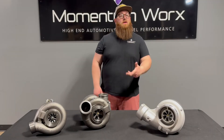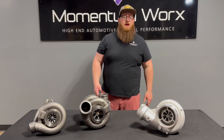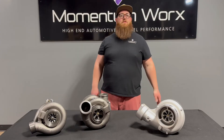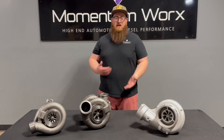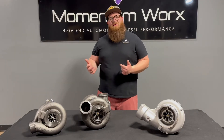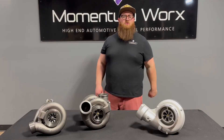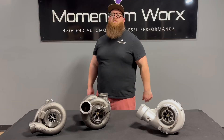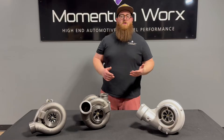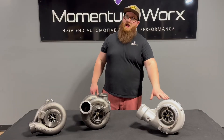Let's talk about power and fuel economy. We get calls all the time — guys say they want to make more power and have more fuel economy. Well, that would be great, but you're just not going to get both. I think in years past there were a lot of companies saying put a single turbo on, make more power, and get more fuel efficiency. And I think the problem was it was just good tuning — they were going single turbo and getting more power and efficiency, but a lot of that was coming down to tuning and not actually the single turbo.